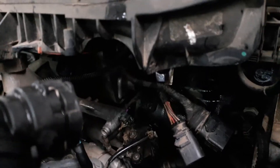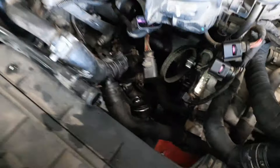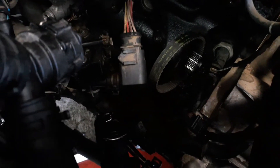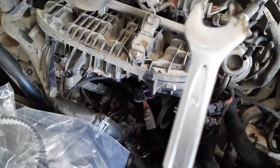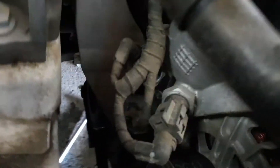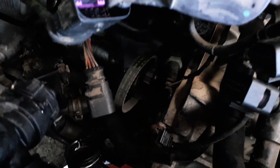Inside there's a small hole where this piece locates into. The next thing we need to fit is a new belt. The belt fits inside there - it's got a number 12, so use the number 12 spanner. That bolt is opposite - you will need somebody to hold the crank on this side otherwise the engine is going to turn. Once that bolt is loose you can take it out. The kit does come with a new bolt and a new belt.